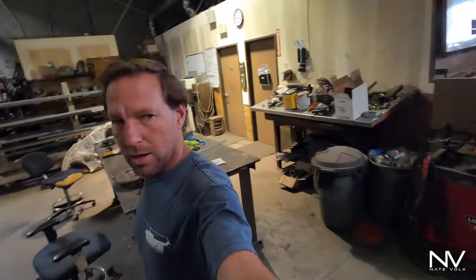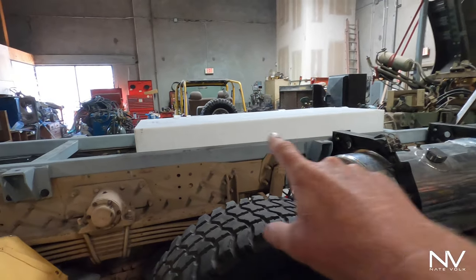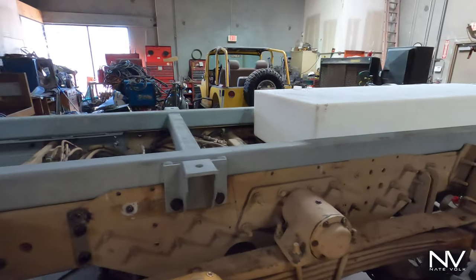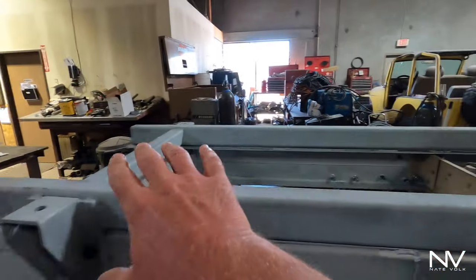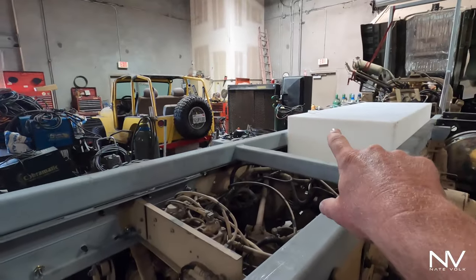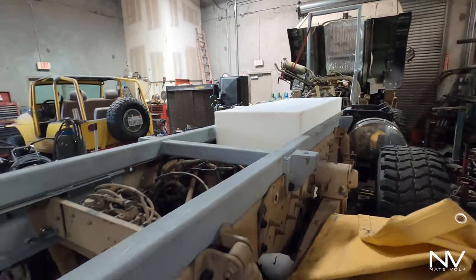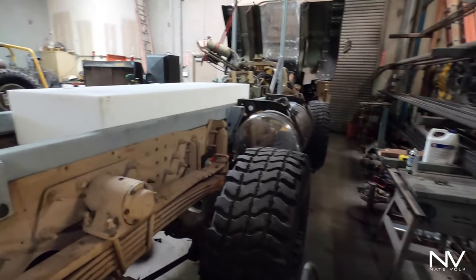The cab is currently stuck up and that's going to be coming down soon once we get some parts. I also set the water tank in here — this is 95 gallons of fresh water. It's going to sit around that area somewhere, I might slide it back a little. This is my secondary tank that's going to be outside of the habitat. The main tank is going to be back here inside the habitat under the sofa — that'll gravity fill to here and go out to the pump. I'll have a little tee so you can bypass this one in freezing weather and just use the inside one, which is 135 gallons.